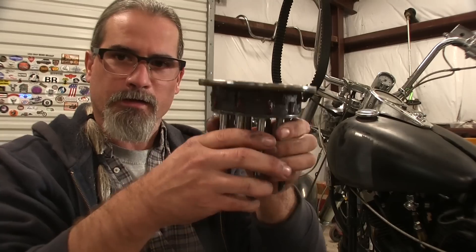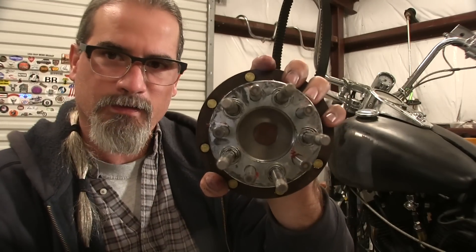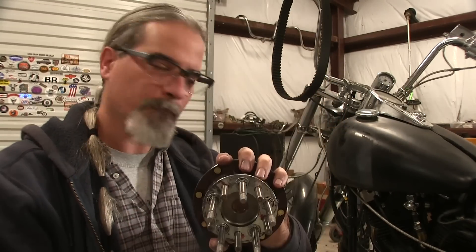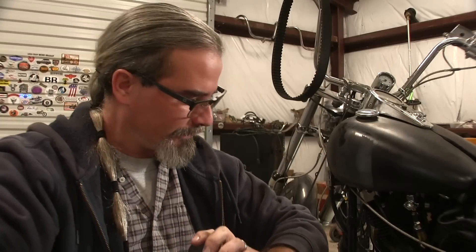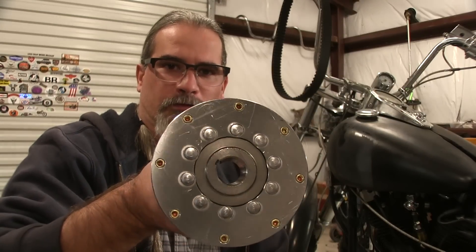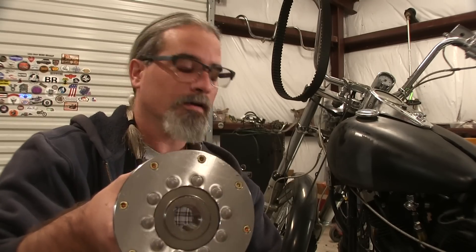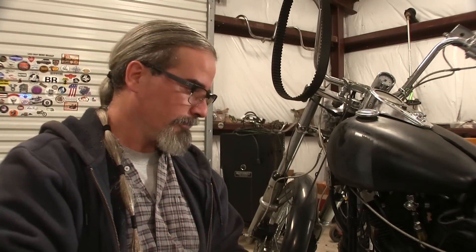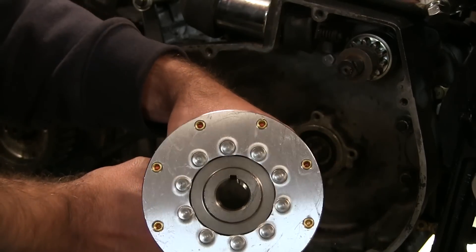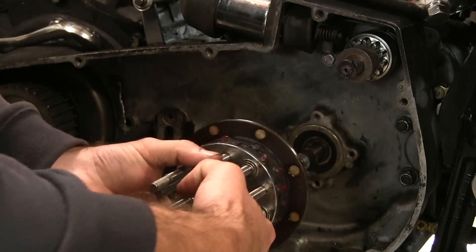I changed my mind a little bit about filming. I got my clutch hub all put together — got the bearings on it, got the retainer plate in there with those springs holding it on. I found a really easy technique for putting your clutch hub onto the main shaft with the woodruff key without knocking the key out of place. Make sure the keyway is at the 12 o'clock position, just like the woodruff key.